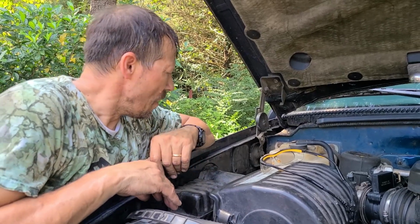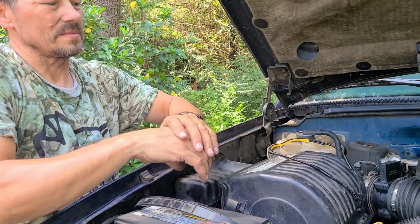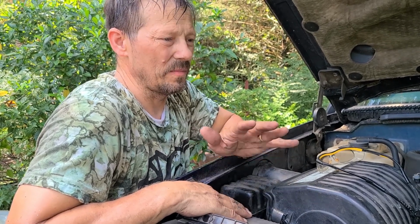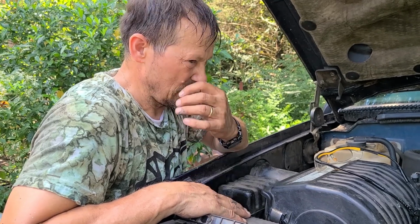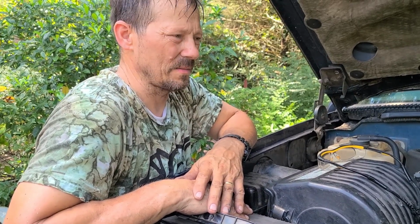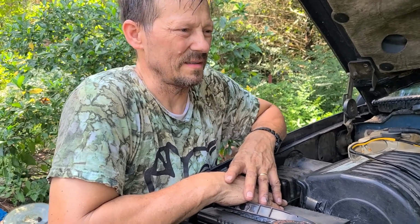So anyways, process of elimination, I think it could have a broken or a worn cam lobe. It might have a couple of valves in the head that are not moving. The only thing I would do with that is just pull the heads off and have somebody check them out. I can't take them down or nothing. I don't have any experience with valve jobs and all that. Even though I messed around with that 302 a little bit, I never even tested it out. I need somebody to help me finish that one.